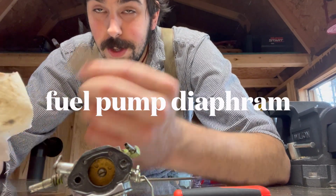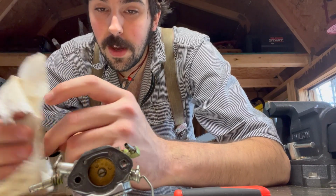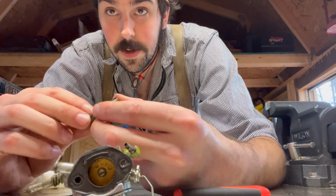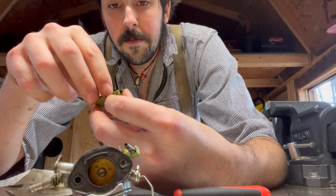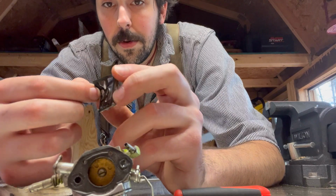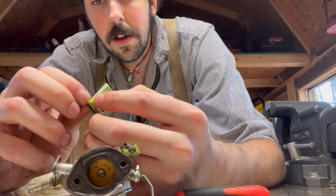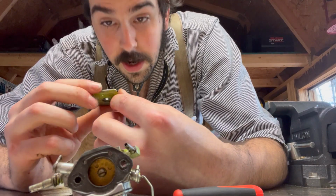But so this is not your gasket. This is actually what makes the carburetor work in tandem with your impulse line. This is one half of it. Then your next layer, keep that because it looks good. It's not hard or rigid. It's good. This is the gasket. Next, it's got this little tab so you can pull it up, and it's not crinkly or bad looking either. There's more of that jelly looking crud in there and rust.